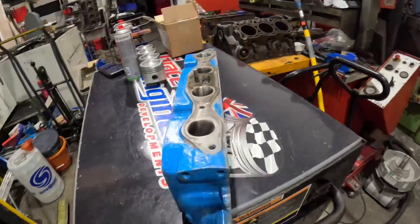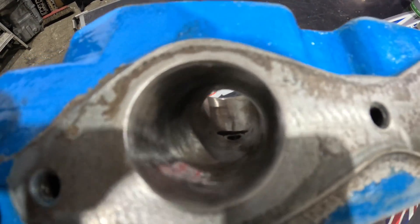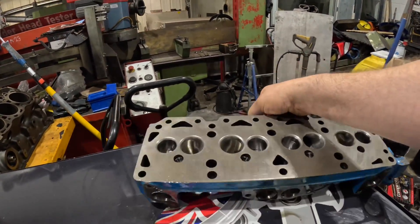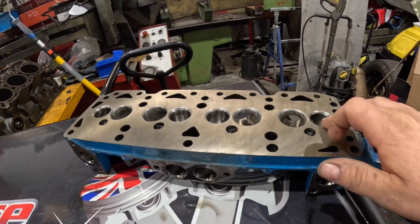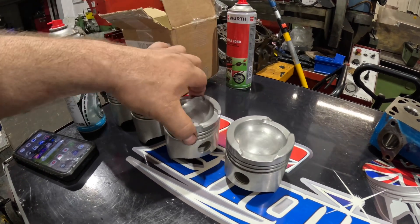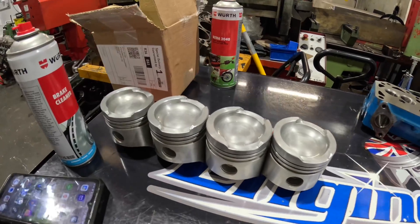Well, that's all the cross flow Formula Ford bits done. This has just come out of the washer - I've just re-faced it. I've tidied up his porting because it wasn't particularly very good. We've levelled up his cylinder head again because it measured differently all over the place. All the valve seats now are at the right height. Tidied up the exhaust, although I do think we could get away with a bit more work on them as well. And then I've machined his pistons to get the combustion chamber at 41cc - it started off at 39.2, and they're all spot on now.